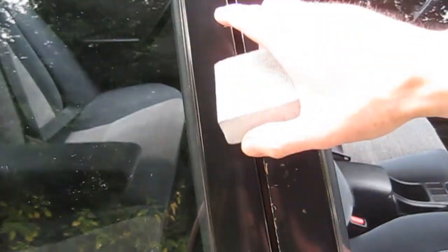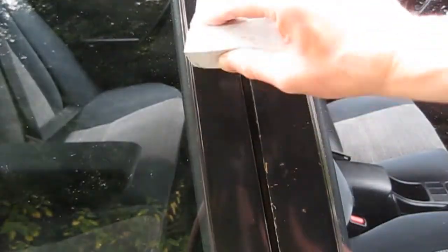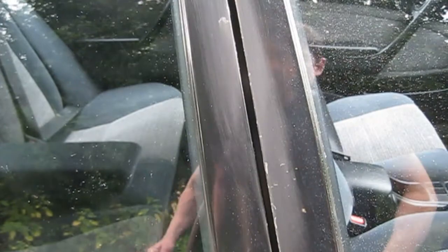Washed and dried off, wiped it over with a paper towel. So what I'm going to do is go in and sand these little bits of rust off just with a 180 block. I don't want to go too mad with it because I'm only just going to blow this over. It's not going to be a full back down to bare metal all over job, just to tidy it up and clean it up a little bit, and then we'll give it a good clean and we'll mask it before primer.